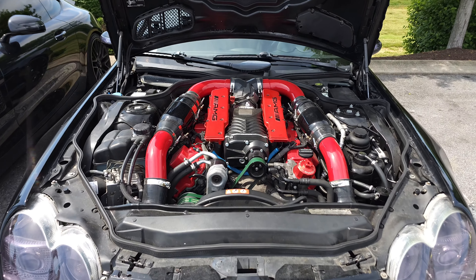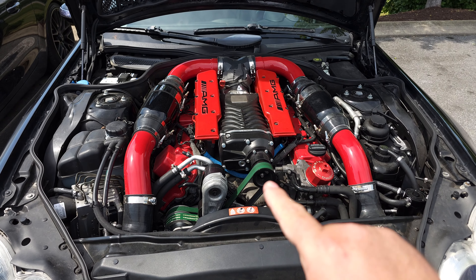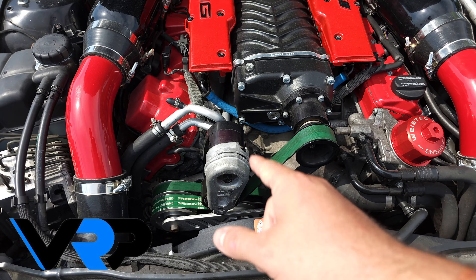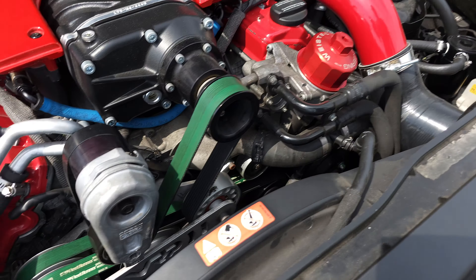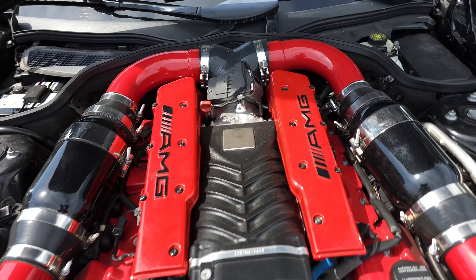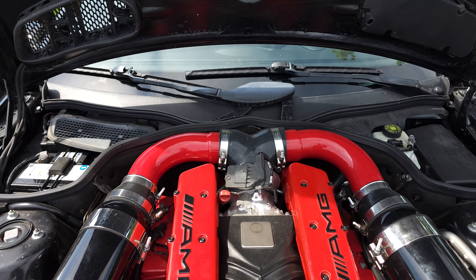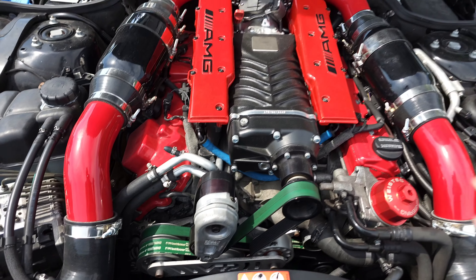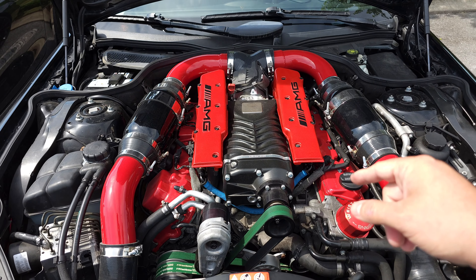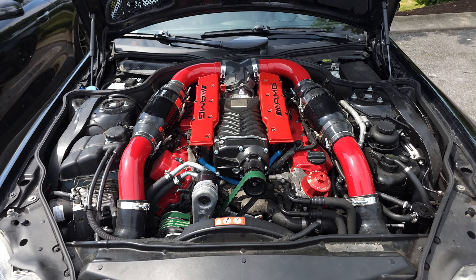Let's start with the SL55 so we're clear on what we have here. This is a VRP Whipple Gen 4 2.9 liter. We have the VRP belt wrap kit with a VRP HD tensioner - looking awesome with dual HD belts. We have this awesome intake welded up to three inch so it goes in the coupler real nice. The three inch has a Hellcat throttle body. This is the SL55 with the VRP cams - this thing has some chop.